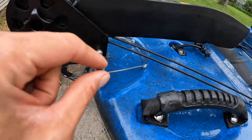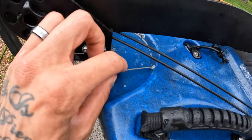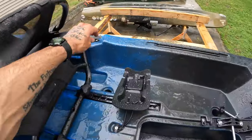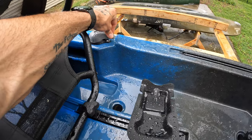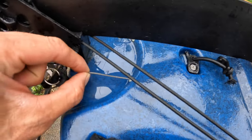The first thing is these steering cables. These are nylon cables that aren't really rigid enough, and so what happens is there's a whole lot of play in the steering knob. What I intend to do is replace these original cables with steel coated cables, and that should take a lot of that play out of it and make the steering quite a bit smoother.